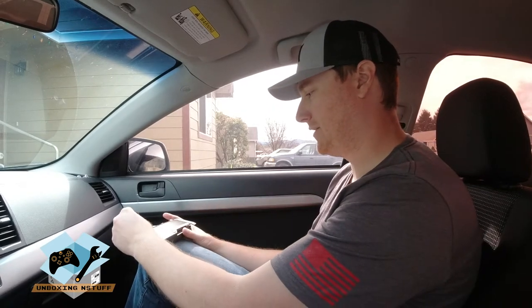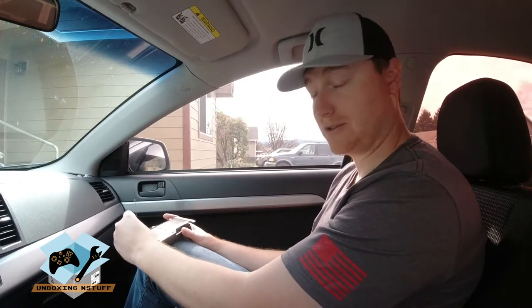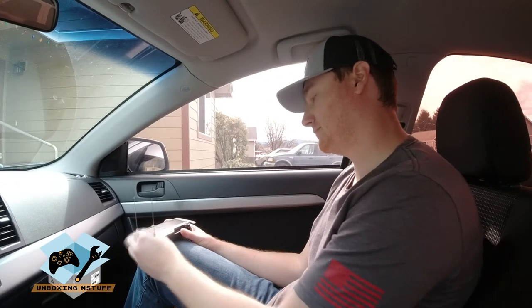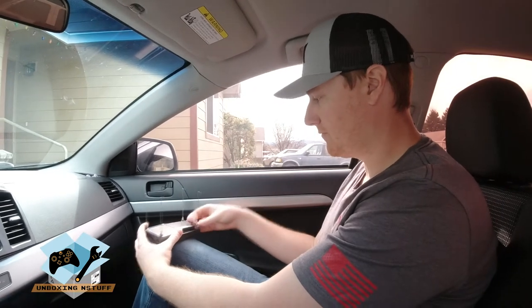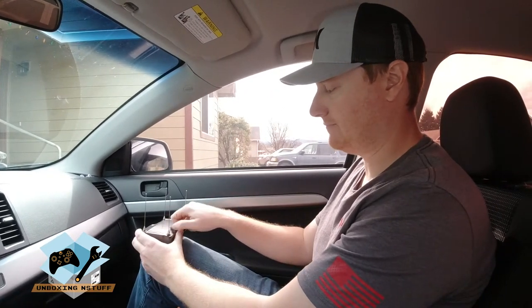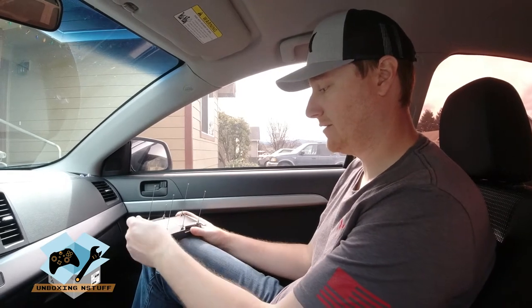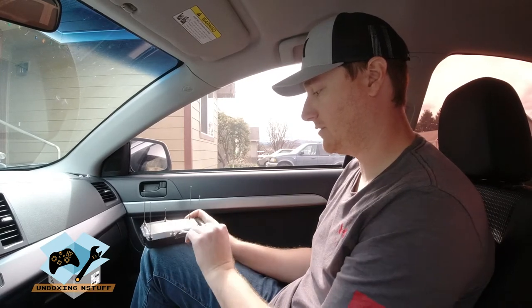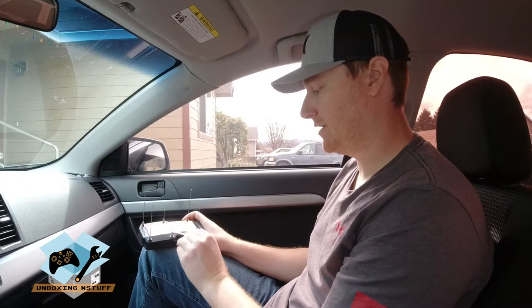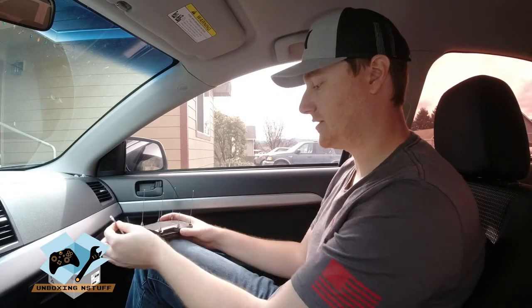The simple way to remember on this is the big antennas — the longer ones — go towards the front and back of the booster. We're going to take our included small wrench and do a light snug on each one of these so they do not rattle loose while this is on top of the vehicle. You don't need to wrench it down real tight, otherwise you might break it — just till it's snug.